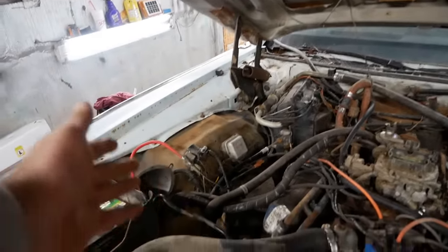Yes. Down into here were two safety zip ties. Zip tie that brake line right where it needs to be. We'll have to pop that bleeder open and see if we can bleed it. Nothing. Nothing? It's not actually coming out of the bleeder, but it's coming from the threads. That bleeder was full of crap. I cleaned it out. Let's see what happens now.